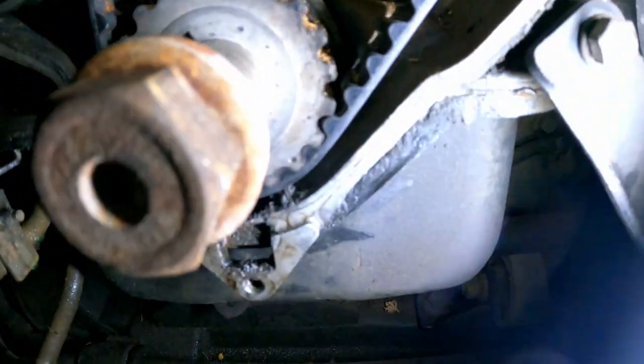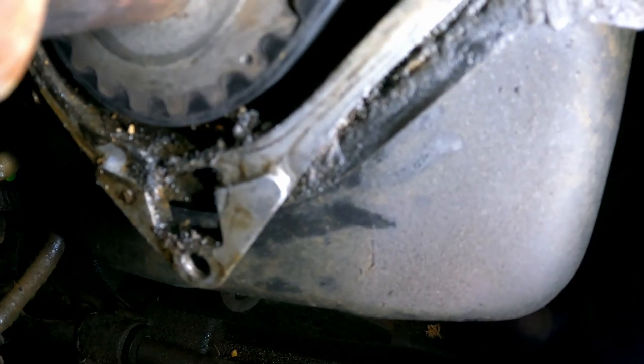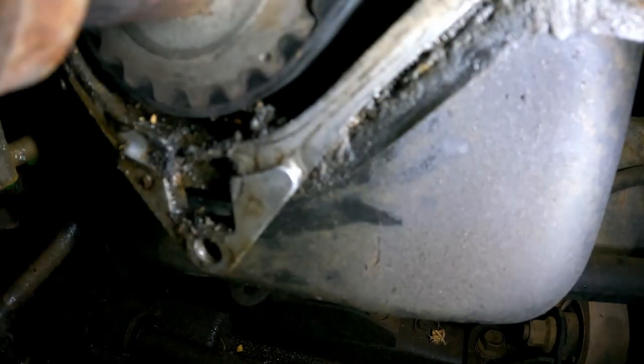All right, moving on. Down here on our crank, on that bottom tooth, you'll see that divot stamped in. Well, that divot is supposed to line up with this corner mark right here, this shiny corner mark. That's the nearest I can tell, according to what I'm reading in the little manual. So anyway, that's what we've got right now.